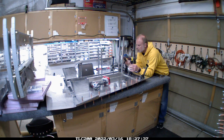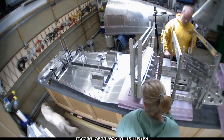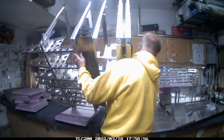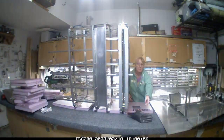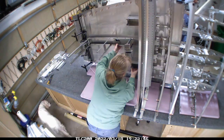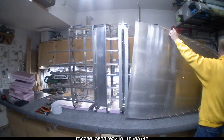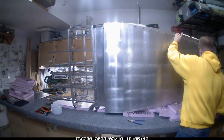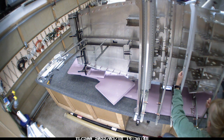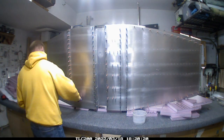Here I'm working on getting the stops for the rudder pedals set in place. You have to shave about 10 millimeters off of the stops to make sure that they clear. I got the foam set up and my wife Lori's out helping, because I needed some anti-corrosion material for the stainless steel rib nuts to rivet the bottom skin onto the main spar. That had come in just the day before this portion of the video was recorded, so I could proceed with this step and had a good evening of work planned.